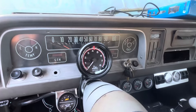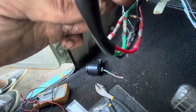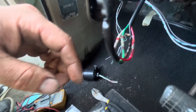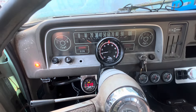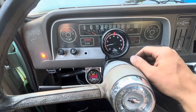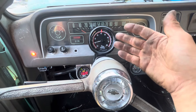I've got the tach in here, kind of mounted up and ready. What I did was loop a resistor between the signal wire — which is the green — and the power wire — which is the red. That supposedly gets you the voltage you need on your signal wire, which you don't get from the PCM. Now when I fire it up — there we go. You can see it's got to idle down a little more yet, but it sits right at about 900 RPM — that's what I have it set at due to my lack of tuning knowledge. That's just my get-it-to-run tune, but she's working. Pretty happy about that.